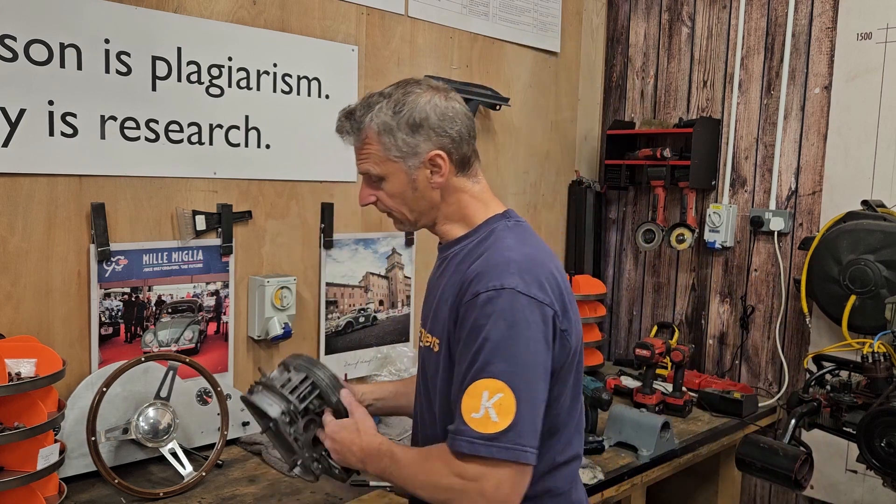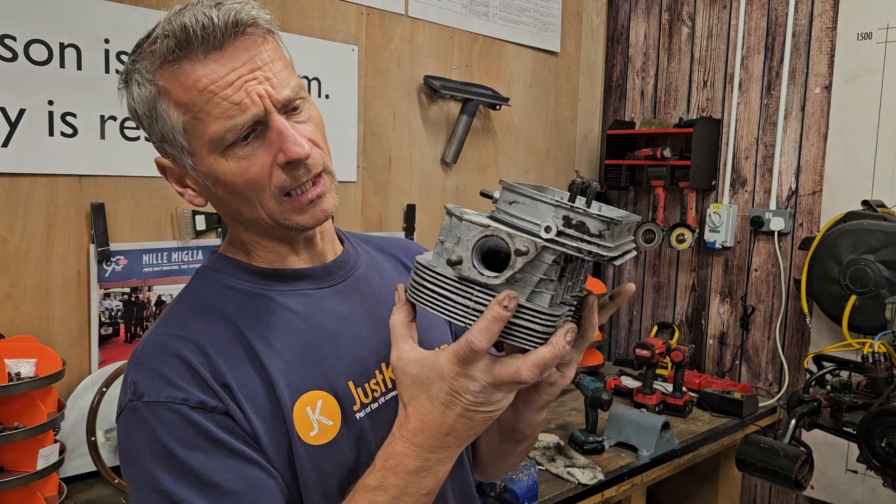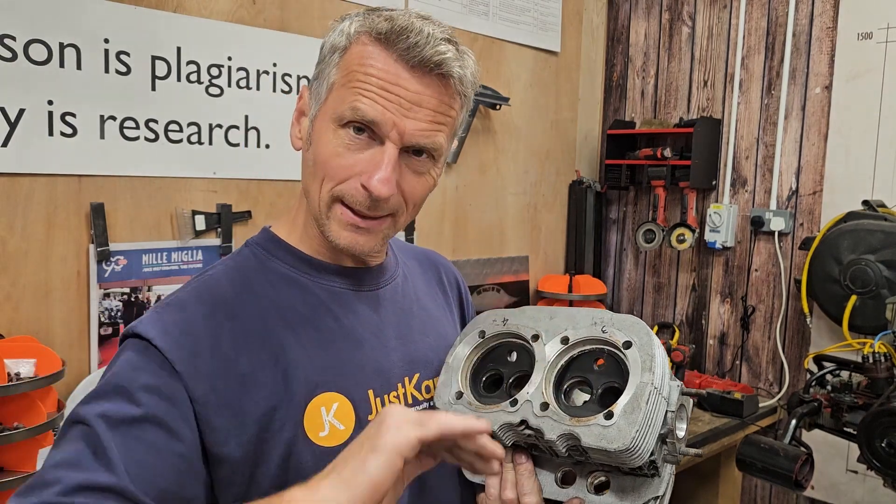While it's all apart we're going to clean up the valve seats, re-grind and lap the valves in. I also did a bit of cleaning up on the ports. The exhaust ports weren't great — there was some funny edges on them and quite a large build-up of carbon. This is one of the cylinder heads — the exhaust exit was quite lumpy and not very smooth flowing, so I've dressed that up to a nice smooth exit on both cylinder heads.